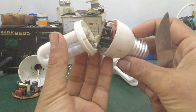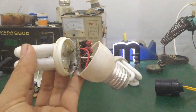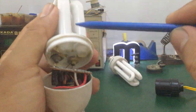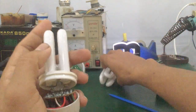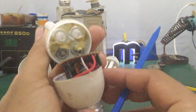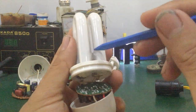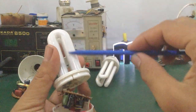Inside there are two parts. The first part is the bulb section. It will have two U-shaped fluorescent tubes, or some models have three or four, depending on the lamp design and wattage. The tubes are connected in series — they must not be broken apart. If the tube breaks, the lamp definitely won't light up, because it relies on the electrical discharge process.